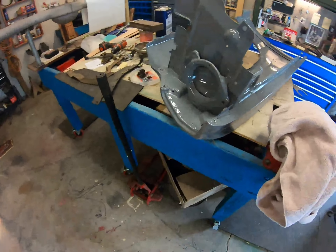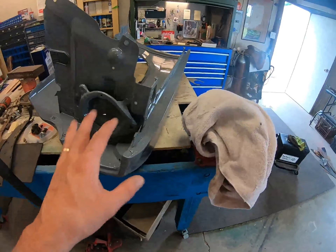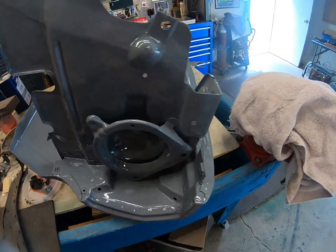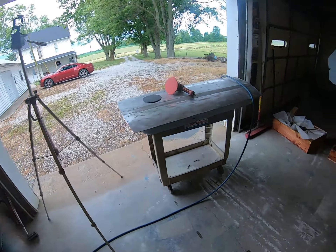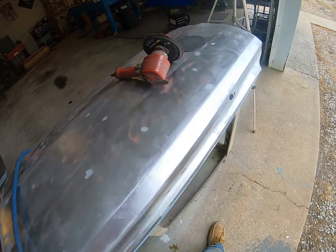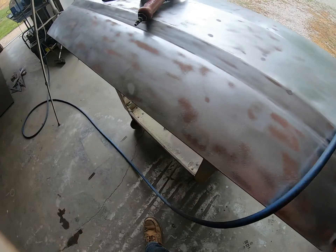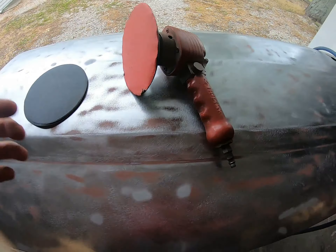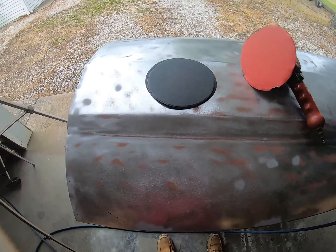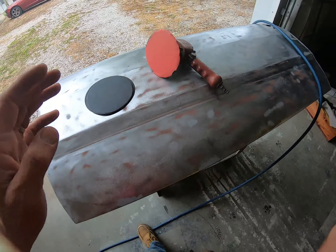We'll wipe everything down really well after we blow all the sand out, then it'll be epoxy primer time for all four panels we're working on. We're into another day on this project. After our spot blasting yesterday afternoon, it cleared up some areas where I wanted to go ahead and coat. This was on the first fender from the last video — I coated all the little side areas. I'm not putting it on any of the external skin areas, just the hidden areas. Now I want to even this out and get what's left of the red oxide primer off, going from 80 down to 180 grit. We'll do this on both doors, and when the POR-15 dries on the fenders, we'll flip them over and do the skins as well, then we'll be ready for epoxy primer.